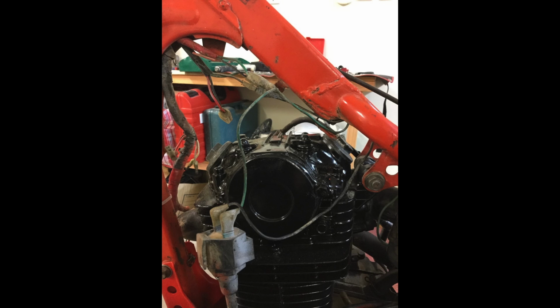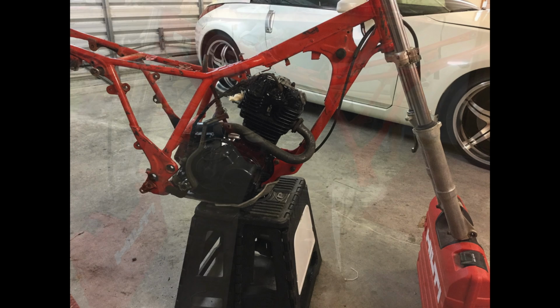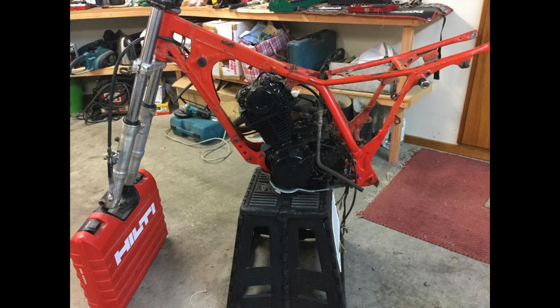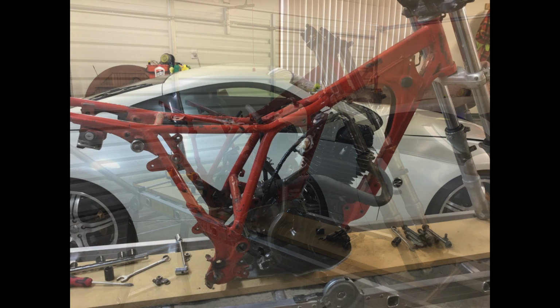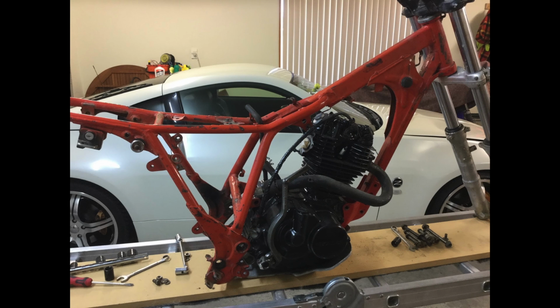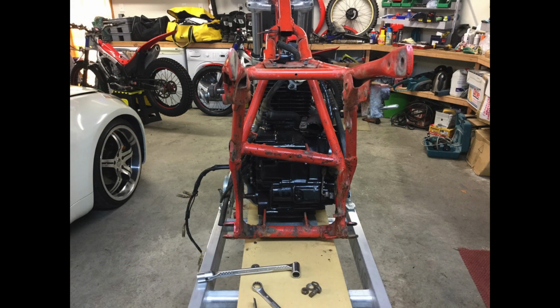Spokes we decided needed replacing, they were fairly well rusted and well past their use by date. So we got a local wheel lacer here to supply both wheels with new spokes and nipples. And we spent some hours lacing those ourselves. It was a bit of a hit and miss job, but we got there in the end. Luckily, we had previously taken the offsets of the hubs, so that was a bonus. And they went together okay. I walked away from it a couple of times and came back, but generally it was not a particularly satisfying job to do, but once you'd done it, you were satisfied.